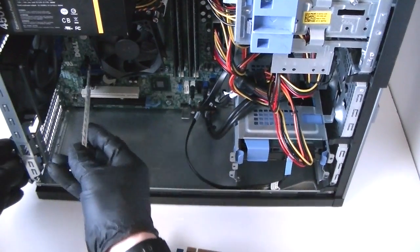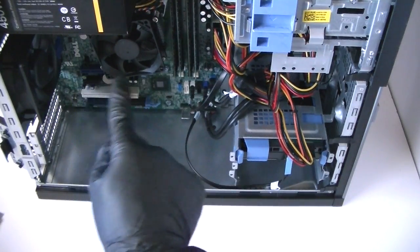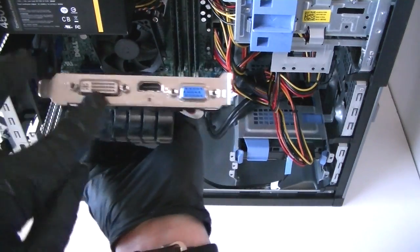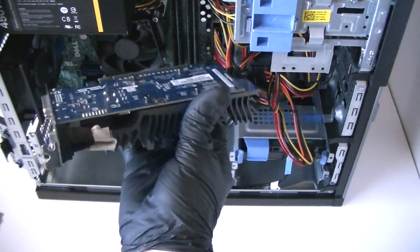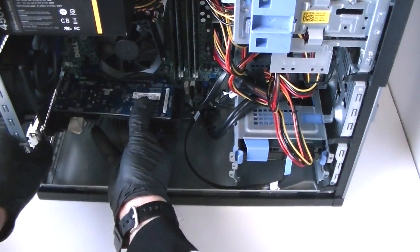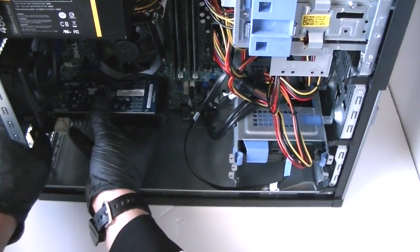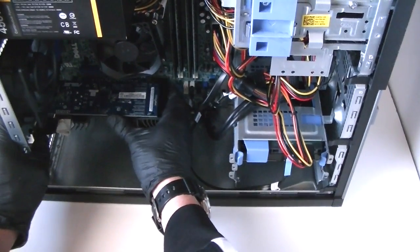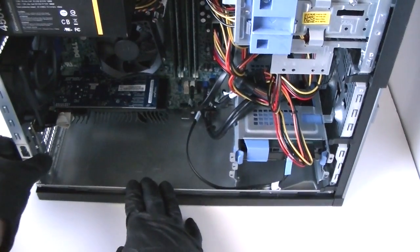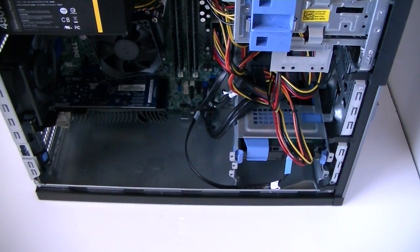So let's remove the PCI bracket and install the video card into the PCI Express X16 slot — that's the blue one right here, the top one. I'm installing a video card with DVI, HDMI, and VGA — this is for dual monitor use, not a gaming card. If you're going to install for gaming, go with at least a 500 watt power supply. Connect the power supply to the video card and there's a secure lock right here. That's it guys — we installed the power supply and the video card upgrade on the Dell OptiPlex 7010 Mini Tower. Thanks for watching!